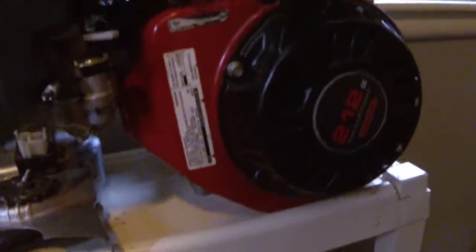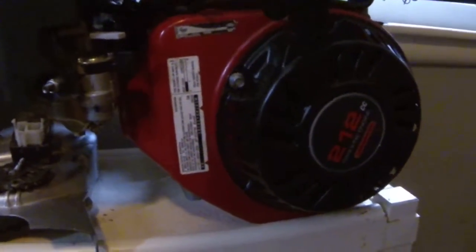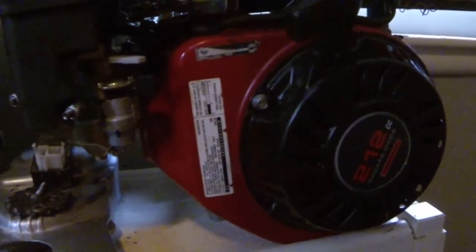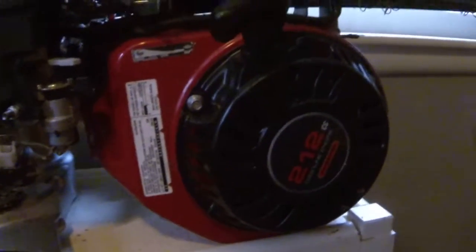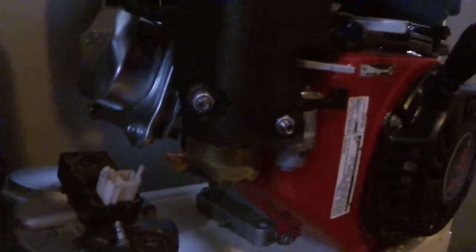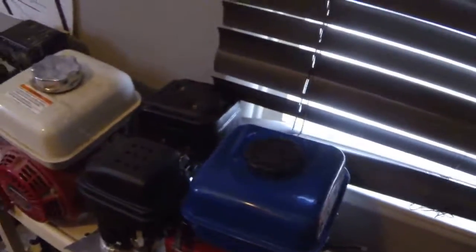I can't even remember what crank I put in there. I know it's a clone crank with, I believe, a Harbor Freight stock rod, with the clone piston or a Harbor Freight piston. And then I just literally took a random clone head that I had off an old LCT motor and made everything work, clearanced everything, and it started up second pull, and the thing runs like a top for what it is.